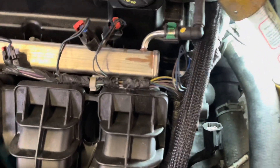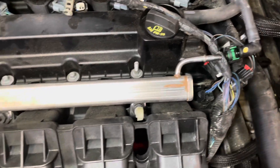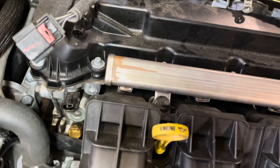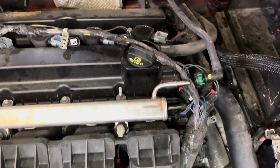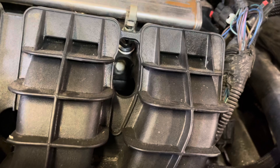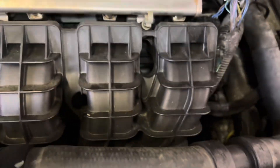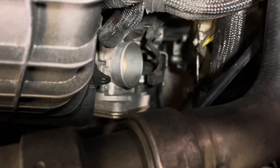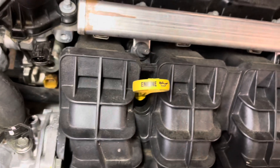The next big thing we've got to get out of the way is the fuel rail, and we've got to get a couple of vacuum hoses pulled off. We disconnected the fuel line at the quick disconnect — squeezed the green tabs together and slid it off, pretty easy. We disconnected all the injector harness clips and took out the PCV hose and a few sensors on the head. You don't necessarily have to do that but it does make things easier. We also pulled off the brake booster line, another vacuum line on the throttle body, and the MAP sensor.